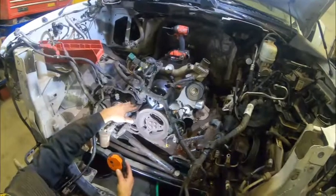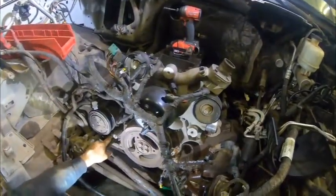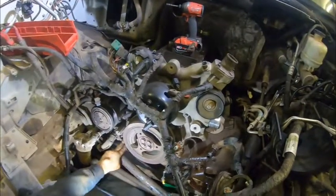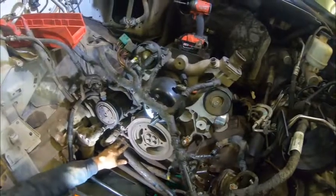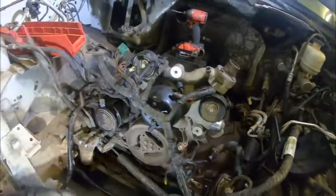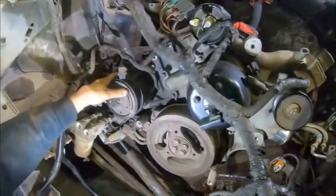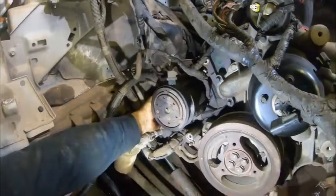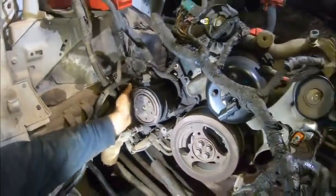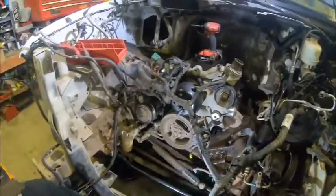What we're going to do is pick the engine up while it's still in here and pull that bracket. That'll allow your transmission lines and the entire wiring assembly to stay right where they are so you can continue to pull the engine out. It usually makes it a lot easier to pull the AC compressor before you do that — but to access the AC compressor it's very tight, so I like to pick up an inch or two first, then pull those bolts.